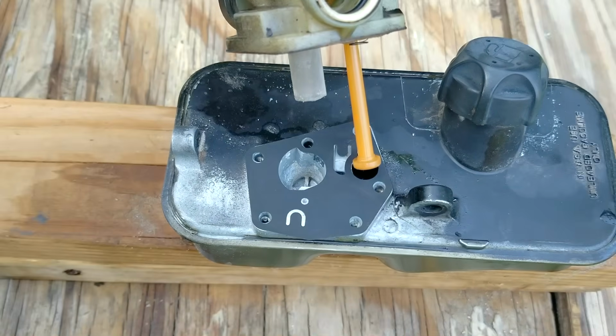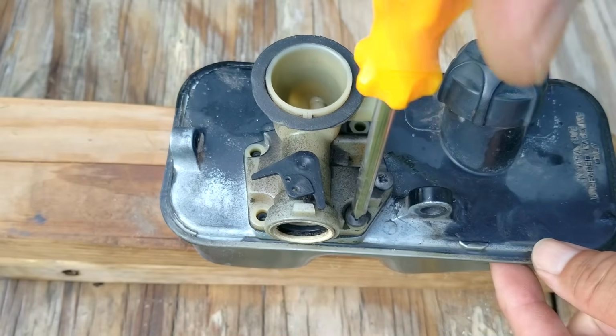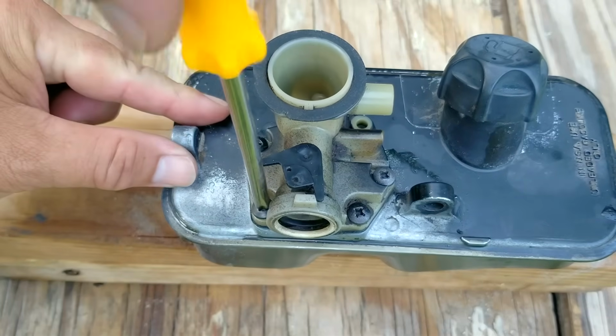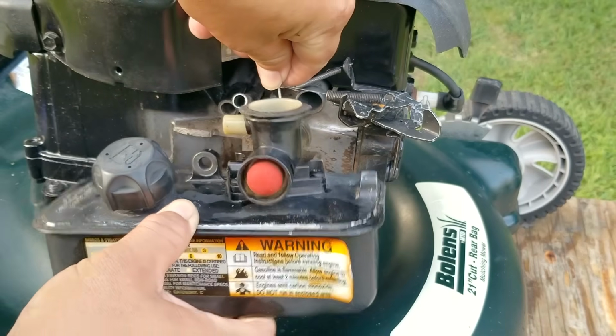Now to be completely honest, I used to not like the way this fuel system was set up. However, having worked on different styles since then, I now admire how simple it is. There's no fuel line to worry about, and you never have to worry about fuel draining into the engine. The real drawback is the fuel tank rusting out, but that's mainly due to poor storage conditions.